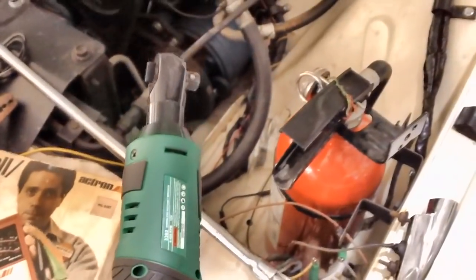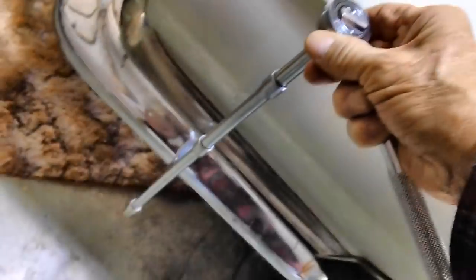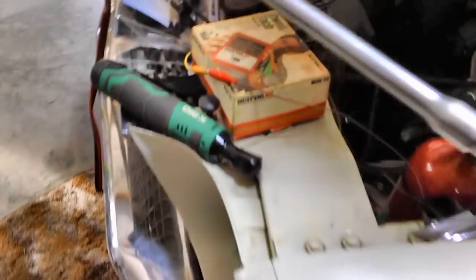The last thing you need is a ratchet. I'm going to use the power one my boy got me, or you can use a regular one — up to you. Then a whole bunch of extensions with an 11/32nd socket on the end that'll reach all the way up in there. You may have to separate them until you get the first one up in there and then snap it together so it doesn't hit the floor. You've got to pull them apart until you get the socket on that nut on the bottom of that indicator.